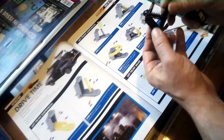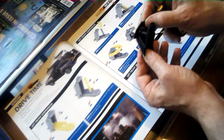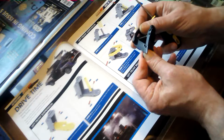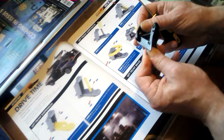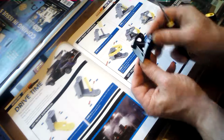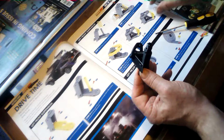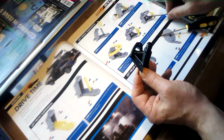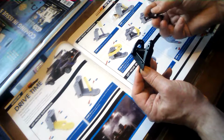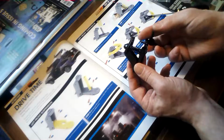Okay, right. I'm not going to do them up too tight because I don't want the suspension to go stiff. That's what you want. You want the top wishbone to be movable, like that. Okay. So we're up to there. Right, what's next? Right, we're fitting the upright now. Or to give it its correct name, it's a swivel hub, but they don't call it that in the book.